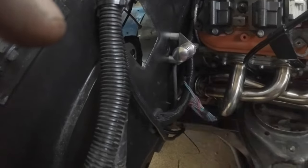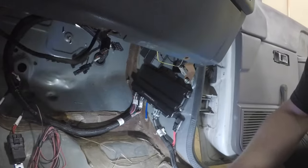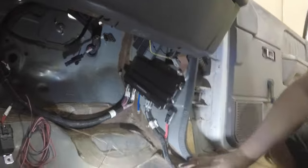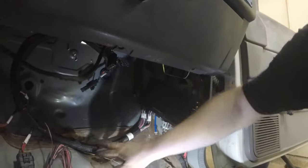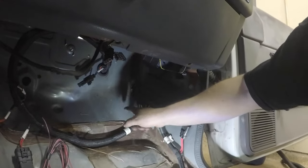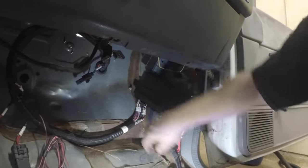I'm about to call it a night. Let me show you what I've figured out and planned. I actually just mounted the ECU - it's on the inside of the kick panel. I'll have to make sure passengers don't kick it, but it's the best place with a flat surface. I've got pigtails one and two in the ECU and actually got the power sorted, so tomorrow I'm going to finish that up.